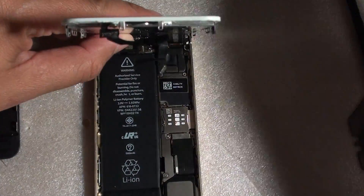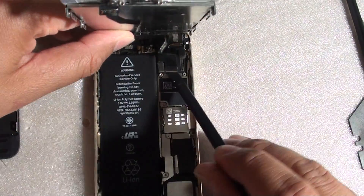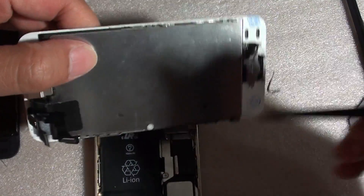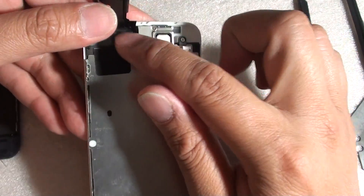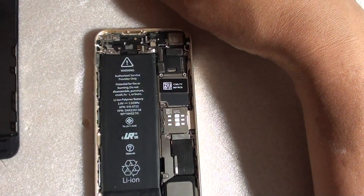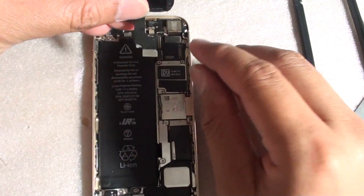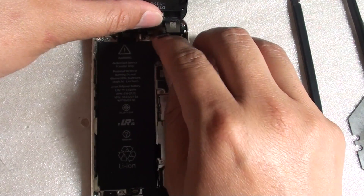I have already removed the screws to make this video faster. Now we can remove the cables — I am going to remove the three flex cables. The issue could be due to the cables or the screen itself, or screws in the wrong place, or a damaged flex cable. To rule out a board or battery problem, we are going to put back the old LCD screen or another LCD screen to test.